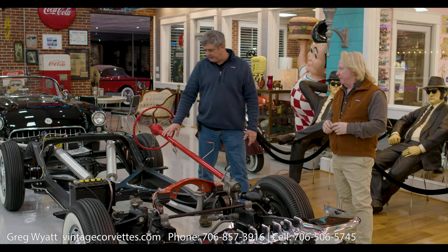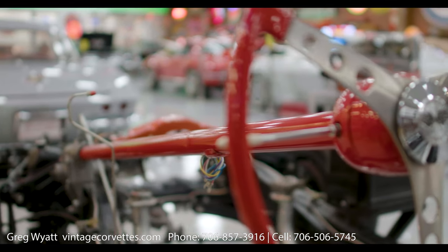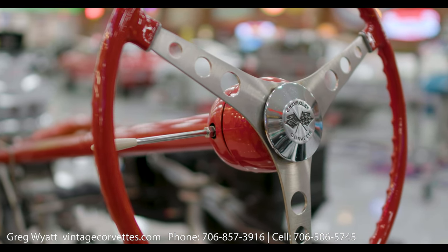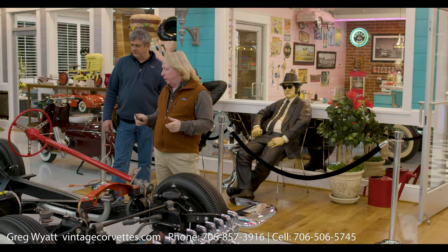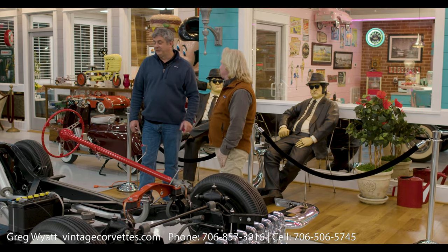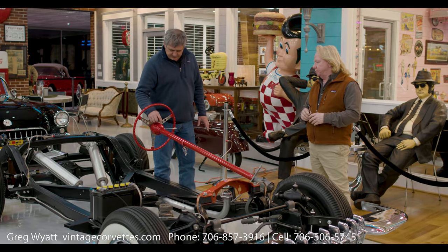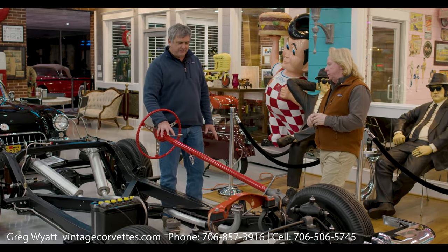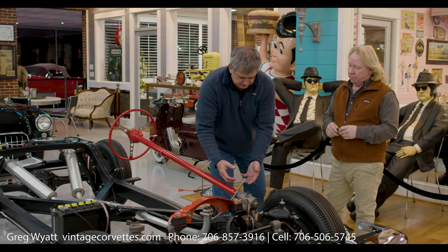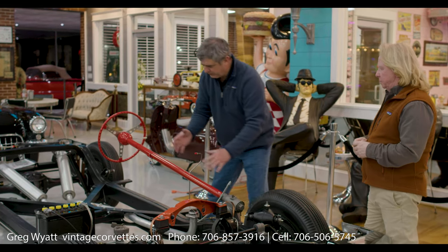And these colors would be indicative if this was a red car — interior color. They would have painted this the matching interior color, and it would have come all the way to here, even in the car. Up until maybe 61, from the firewall to here was black. And another neat thing — this piece and this, it was painted two different places, it's a different color. But you have to take this off because this is a swedge joint, which means this doesn't disassemble, so you had to install this once the body's on.